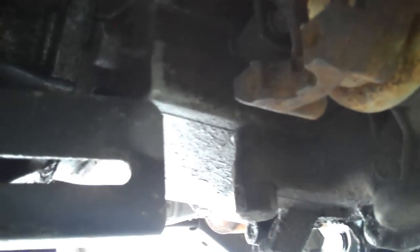We took the transmission mount off and pulled out one of my toys — on our jack here we have a transmission adapter. We take ratchet straps around the transmission and it sits flat on that plate. The transfer case isn't leaking, so there's no point dismounting it — it's just blatantly heavy to deal with. So we're opting to bring the transmission and transfer case down as one piece using this heavy duty jack with the transmission adapter. If you want to make it easier and don't have those tools, go ahead and separate the transfer case.